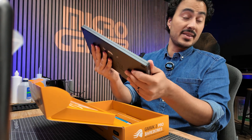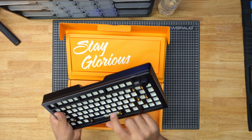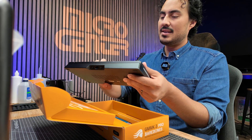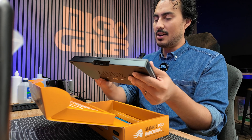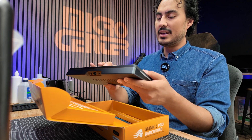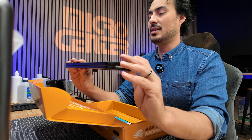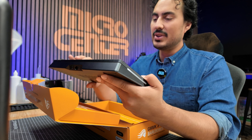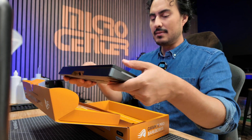The aluminum body means it's not going to flex — I literally cannot physically bend this, it's rock solid. You can feel the PCB underneath and it's not flexing either. Some keyboards get some flex in certain parts where the PCB is not well supported. Some of the components inside you can actually remove if you want a softer feel underneath. There is sound dampening foam in here, so you're not going to get that hollow sound when pressing on the switches — some plasticky bodies without sound dampening foam can sound really hollow, but I think this one is going to sound great.